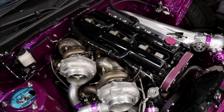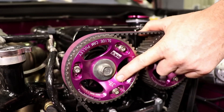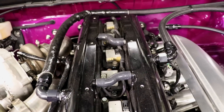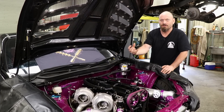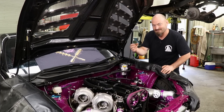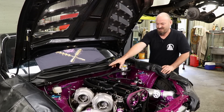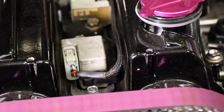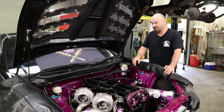A lot of work has been put into the appearance of the engine. All the things that make an engine practical are gone so you can see everything — and don't put your finger in here. The coil packs are Subaru coil packs from a WRX. That's something Myles and I came up with years ago when we were trying to find a coil that wasn't constantly failing on a 2JZ, because the standard ones are pretty prone to failure. We use them over Yaris coils because they're very short and fit down low. As yet they haven't caused a problem — we may have to replace them with R35 units later if they ramp the power up.